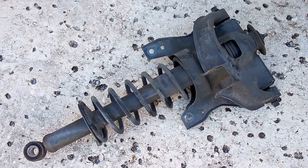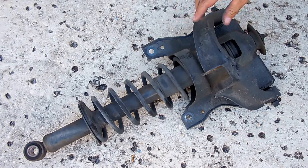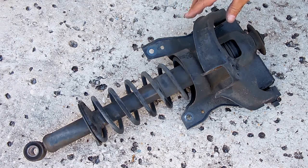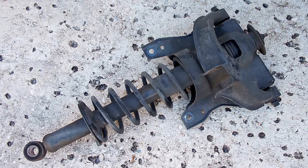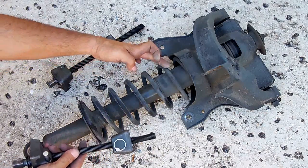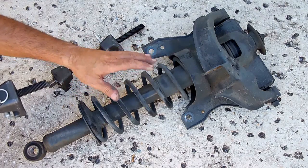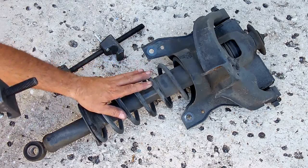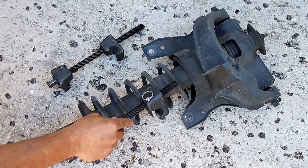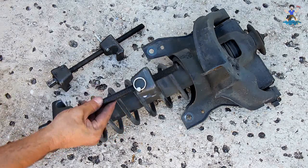When you purchase struts for the front of your vehicle you can buy just the gas shock or the complete assembly with the spring. But for the rear, because all this steel part is bolted onto the vehicle, you'll normally be putting the spring on yourself. Let me show you the spring compressor tool — it's designed to hook onto the spring and compress it. Once the spring is compressed, the gas shock will have a lot of play and then — and only then — can you take off that nut on top. The shock slides out and the coil spring remains. This tool is normally supplied to you for free at the parts store when you purchase struts; just leave your credit card. You can also purchase them for maybe $35-$40 if you want to keep them.